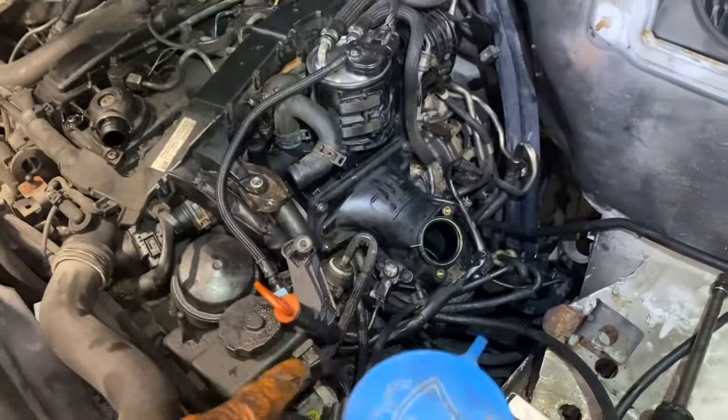EGR cooler reassembled and bolting it all back together. The two bolts in the back went in not so bad on the second visit. I wasn't happy with the way the EGR valve was working - it wasn't closing fully even after I cleaned it off. There was still a small air gap, so I contacted the customer and advised replacing the EGR valve. While the cooler was out I power washed the inside of it to make sure it was clean and water flowing through it properly. Coolant refitted and other bits and pieces going back in.